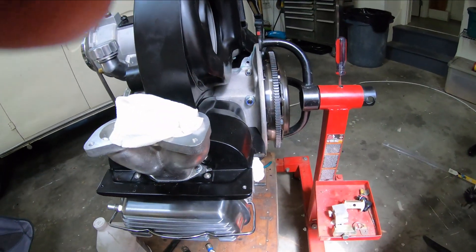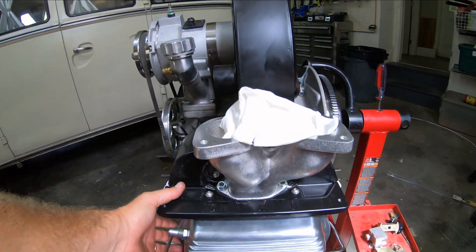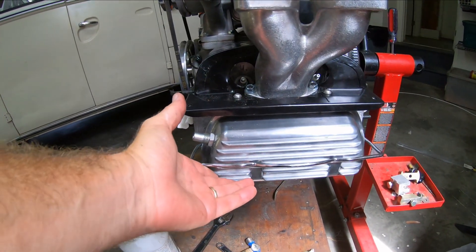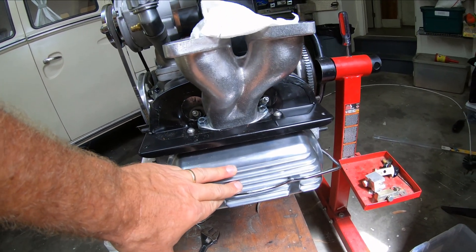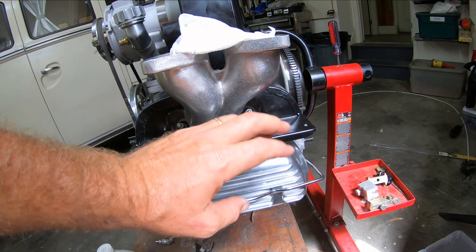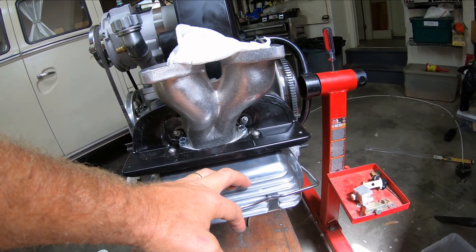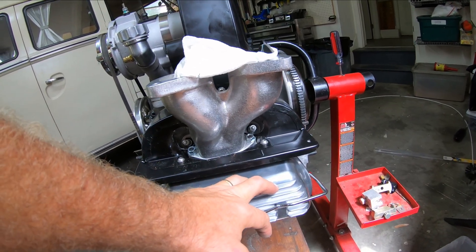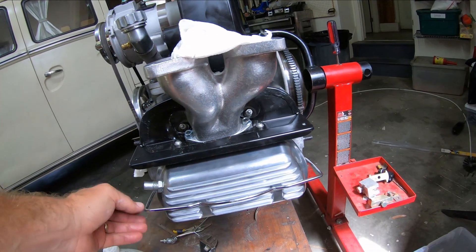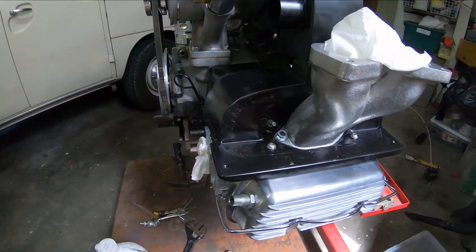Let's check the status of this motor. I've got the four spark plugs in, the cylinder heads taken care of, and all the valve train done — push rods, lifters, valve lash caps set at six thousandths lash. I also have the valve covers on with gaskets.